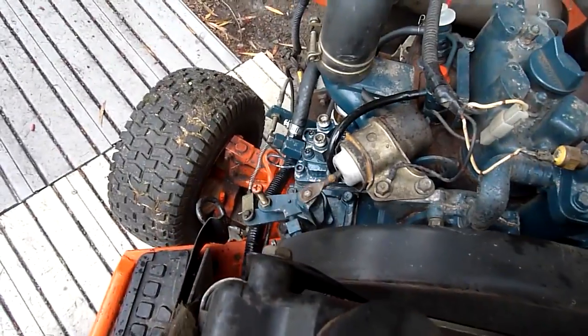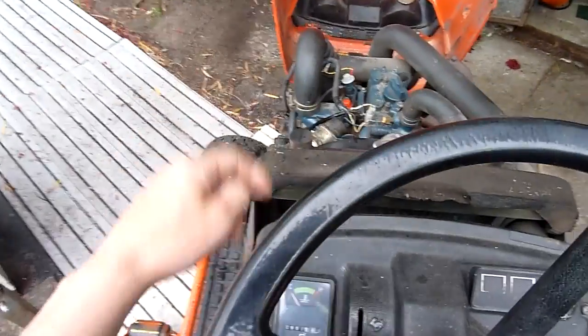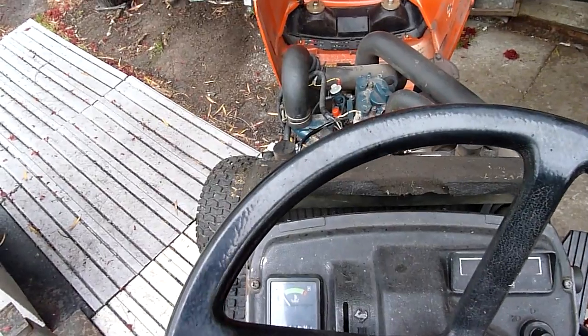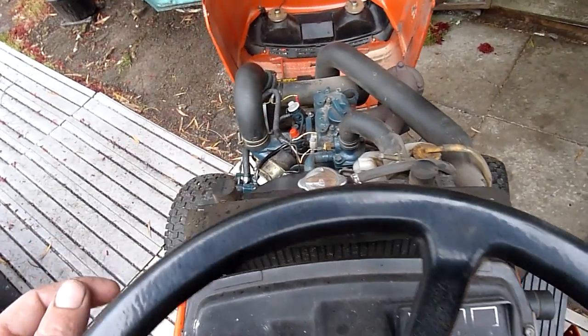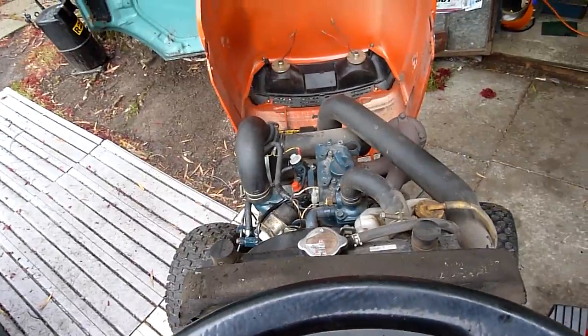That pump's working. If I turn it off, that kills the pump, and if I hold that while cranking, fuel just stops — so there's definitely a governor and everything hooked up properly. Better get those injection lines on and do a start test, and put the rest of this back together again.